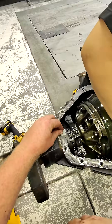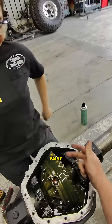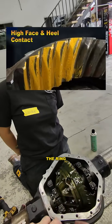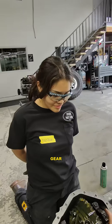Get this surface prepped real quick. What Hooper did is set up the gears for us. See all that yellow paint? They paint the gears and run it through to see where the pinion is contacting the ring gear — whether the pinion's got to go in or out — and you want a little bit of play in the ring gear. It's called backlash.